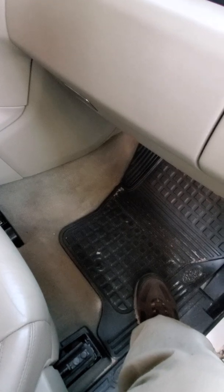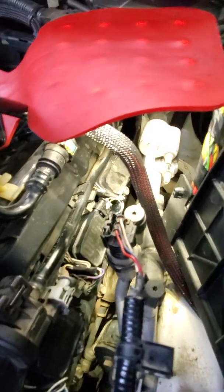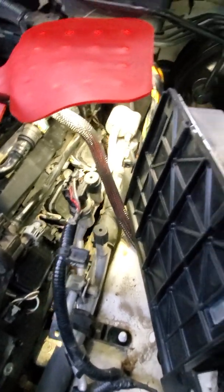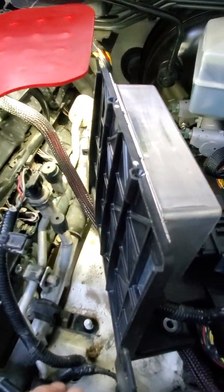Hopefully I can get this plug out without busting it, because I've got to tell you it's tight. The plug torque on these is 20 Newton metres or 15 foot-pounds. I think the torque bolts to hold the — I can't think — it's Friday afternoon. I need a beer. But anyway, I want to get this done.